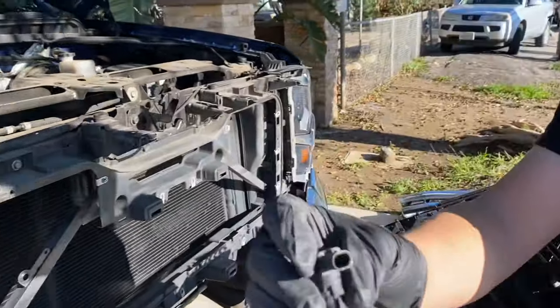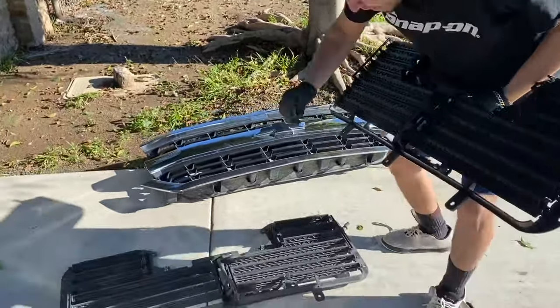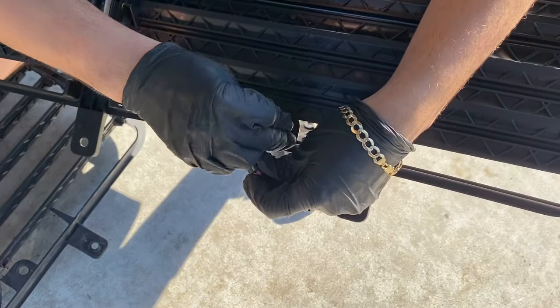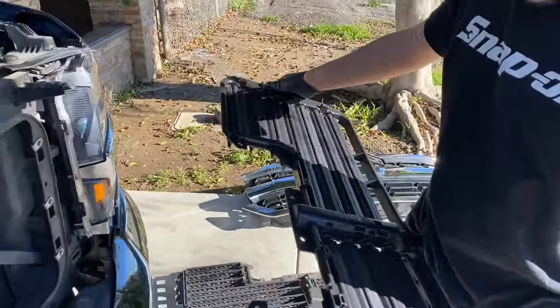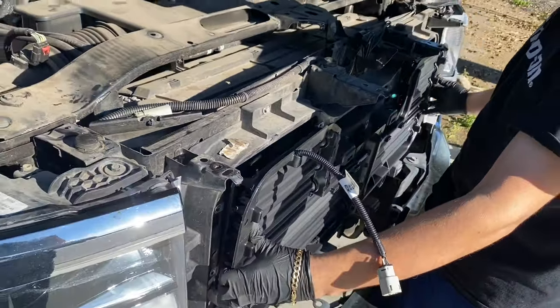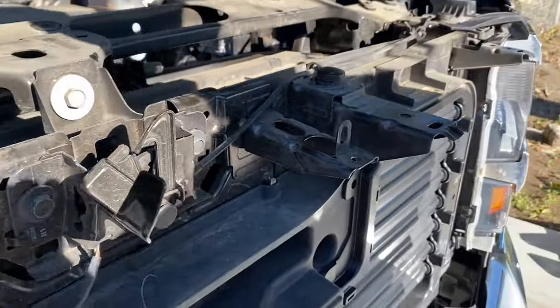By the way, this is a thermistor — the ambient temperature sensor. On the old one it was just here, so you're going to take that off. It already comes with the harness — put it back in here. So we're going to make sure the clips go in right here. We're going to line these up — that goes in here and that goes in here. Put that in there, and then the rest you just kind of mock it up in place. Then you put the fasteners back on.